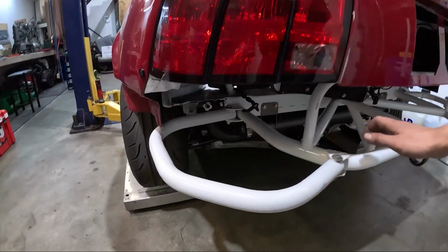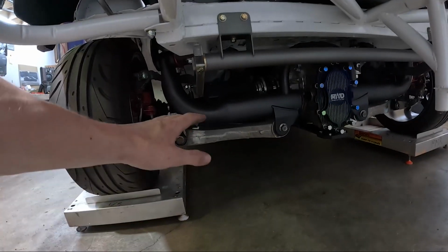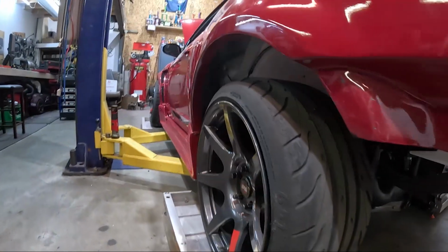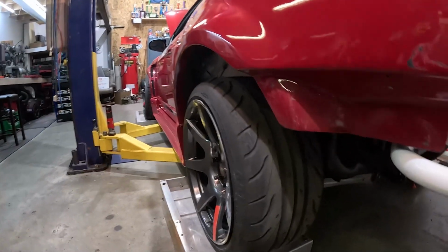It's looking pretty good. We've got clearance in our sway bar. It's real tight, but we have clearance. At ride height, axles look pretty good. They're actually slightly down right now, but I'll get more into that because, as you see, we're pretty high up now. So I have the coil over at the max ride height that I can set it on the shock body. I did that because that's how I had it set with the 5K springs, and I really wanted to see the difference when I put these 8K springs in. And that tells me that it definitely can go lower.